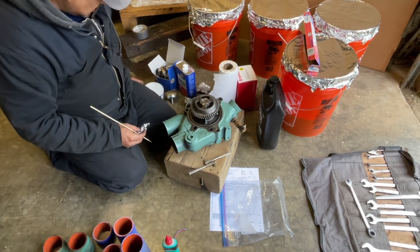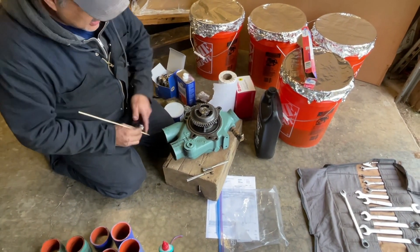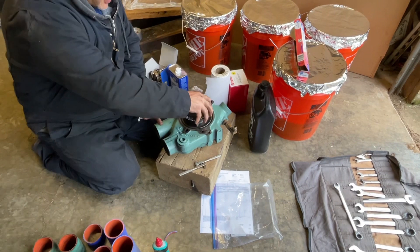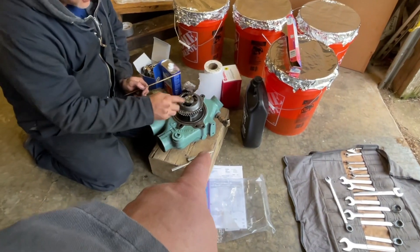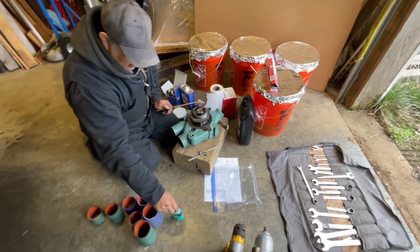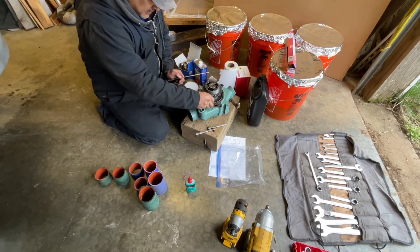We bought a little bit of grease and I've cleaned out the other area. There's no play in this pump and it all seems really solid, so I think I'm just going to put it back in. I re-tapped this one, and I've actually tapped both of those in there already. I ran the tap all the way down, ran it all the way up, put a little bit of PTFE lube in it to make it go a little bit smoother. Yeah, it should be good.